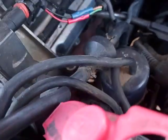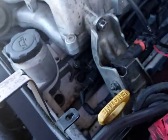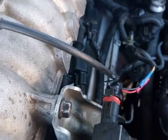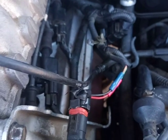We're gonna go to the front. I'm still a little concerned about hearing a spark jump. Again, visual inspection, make sure that this gets tightened down, or put some black tape over this right here. It's got to run for a minute. And like I said, visual timing. And just because this was up here and you hear it, you hear that spark, click, click, and then it jumps. That's a jumping spark causing a short.